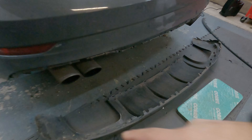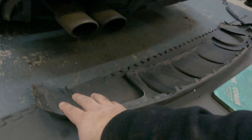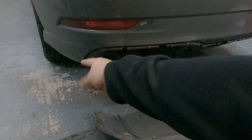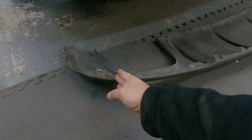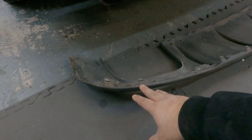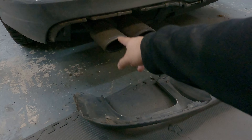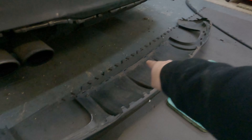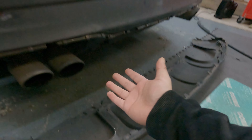So I want to show you how I removed the rear diffuser. The sides were pretty easy — actually the other side was harder; I think it must have been involved in a little damage because the end just cracked off. This side's corner is pretty easy to remove on both sides — you just pull it out from the corner and it'll come up to about here where it naturally unlocks itself. It's a bit tricky around the actual exhaust but you can get to it.